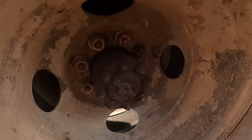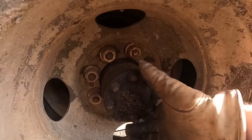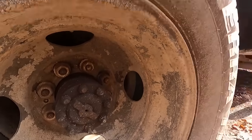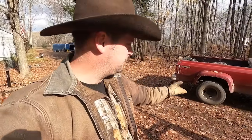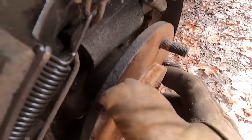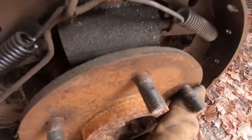There are basically two different setups for this. You have this type, which is called a semi-floating axle, and then you have a full floater, which is more common on three-quarter and one-ton trucks. On a full-floating axle, there's a cap with bolts holding the axle shaft itself. With a full floater, the bearings in the rear wheel are on the hub, so the axle is completely independent from the weight of the truck — that's why they can carry more weight. In this semi-float setup, the axle shaft rides on a bearing, meaning the weight of the truck is on that bearing. If you don't address a bad bearing quickly, you can damage your axle shaft. You can see the amount of play we've got, which is why we're doing this now.